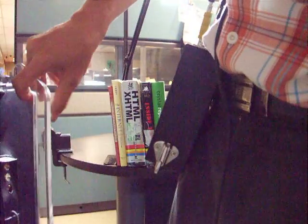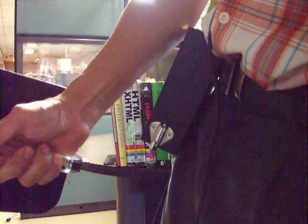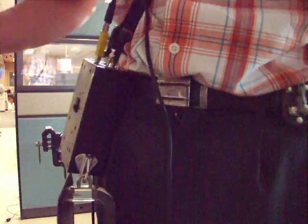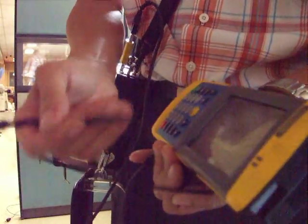So what I'm going to do is move my right hand to this side of the antenna so that I'm holding like that now. I'm going to turn the antenna 90 degrees. Now with the lower part of my right arm, which is this part, I'm going to jam the black box against my body so that the black box doesn't sway, it's jammed to my body. Now with the semicircle ring towards the fending hook, I use some force to bring the ring into the fending hook's position. And when you hear a click, it means that your wand antenna is safely docked onto your black box. Now with your right hand no longer holding the wand, you can use the stylus and operate your stock taking software.